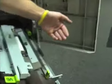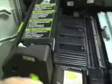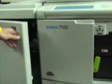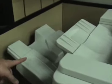The paper feeds up to the top where it then feeds into this portion of the machine, across this, and into the fuser module. Once it goes through the fuser module, it comes over to the output tray which then feeds it to the side where it comes out as a copy.